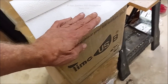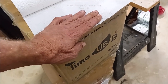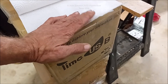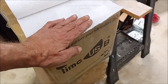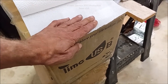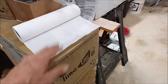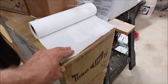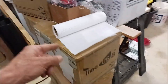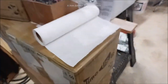We had a set of batteries stolen and my renter had a brand new set of lithium batteries stolen off the front of his trailer. He said he couldn't put the big ones anywhere — they were just barely too big to fit inside the RV. I told him what he needs is 50 amp hour batteries with a 50 amp BMS.